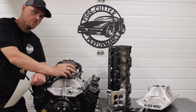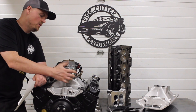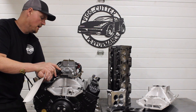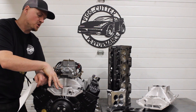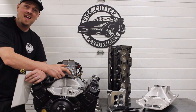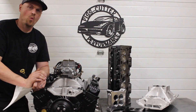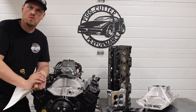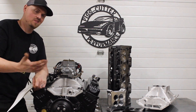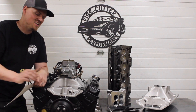The carburetor we used was a Holley 750. This is probably pretty well sized — if you wanted to, you could go down to probably a 650, but no bigger than a 750. We ended up having to jet a little bit differently, and I'll talk about that in the spacer video. With this configuration, the stock jetting was pretty close. Spark plugs: we used the TR6 NGK plugs, almost bang-on for heat range — it's just one heat range colder. For this horsepower level it was pretty much bang on, you could probably get away with a stock plug, but the one range colder worked really well.